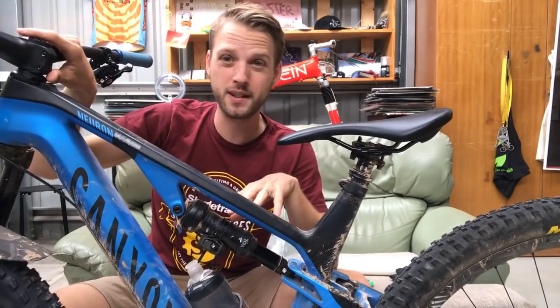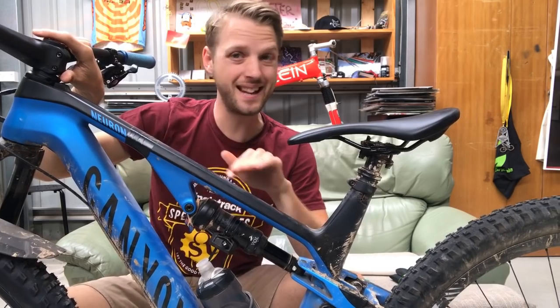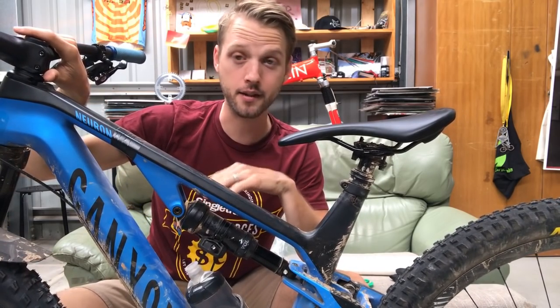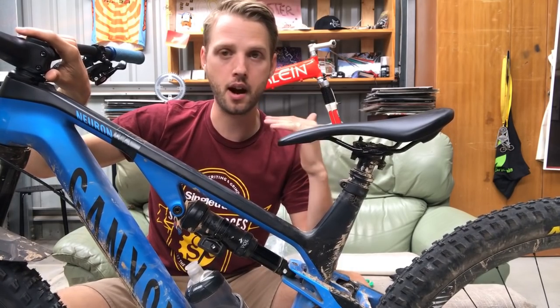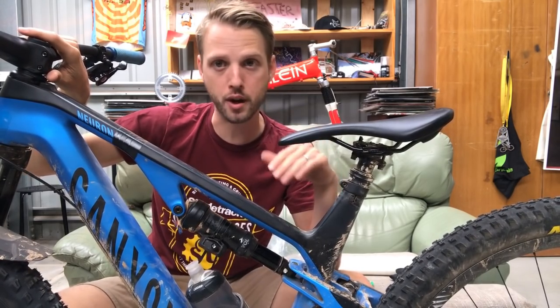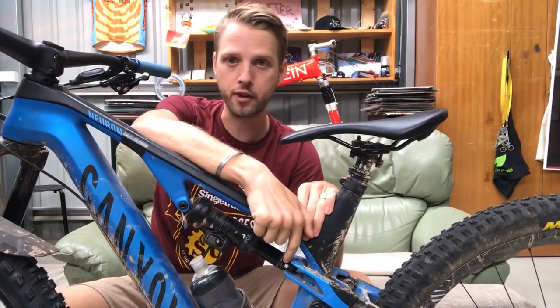It's one of these, and at the moment, the suspension's working really well. It's very effective on this bike, actually. But every now and then, I am kissing full travel, I should say. So a couple of times a ride, even at about the right amount of sag, there are some times where I'm running through the travel and I'm feeling that bottom out. So you're hitting full travel, and you can see the O-ring down here.